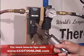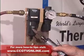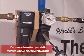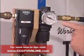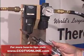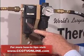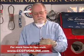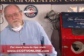This is a little rig I've put together especially for head porting. Here we have a water trap that keeps water from getting into the tool, and over here we have an adjustable pressure gauge set at about 50 pounds. That way I can hold this tool with the throttle all the way down and it will only spin at about 12,000 RPM. I'm going to start with an 80 grit abrasive roll on my air powered die grinder. What do you say we get suited up and get started?